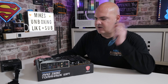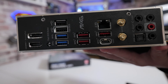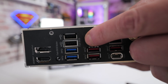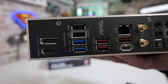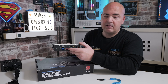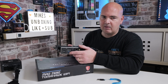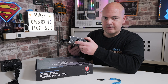Now we've got the file on the USB stick, we can go over to the test bench and flash the BIOS. Looking at the rear I/O, the BIOS Flashback USB port is the one with the marking around the outside labelled BIOS Flashback — the BIOS Flash button is right next to it. Make sure the button actually clicks with a defined click. If it doesn't, the button may be faulty or something is blocking it from being pressed.